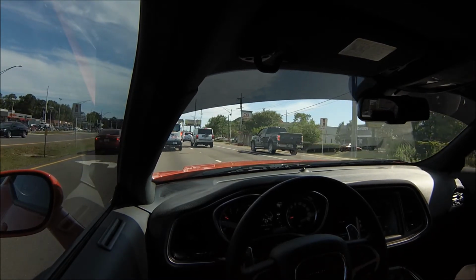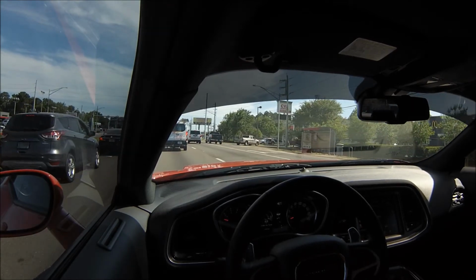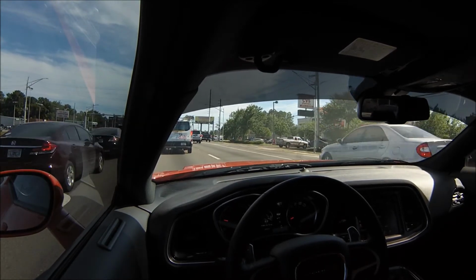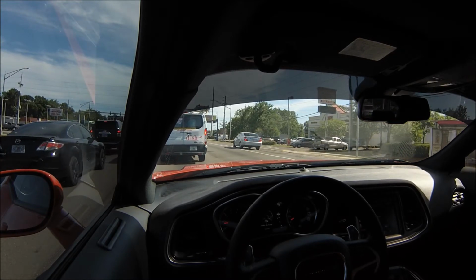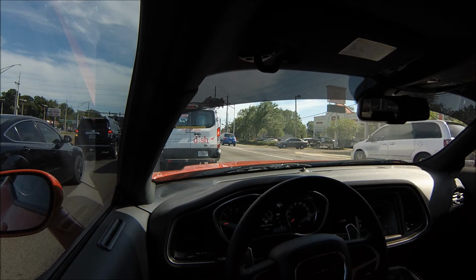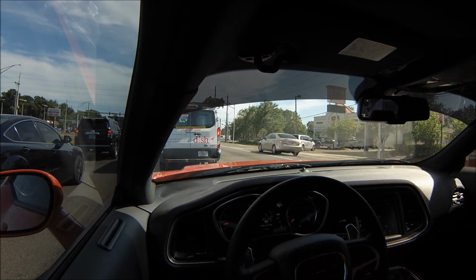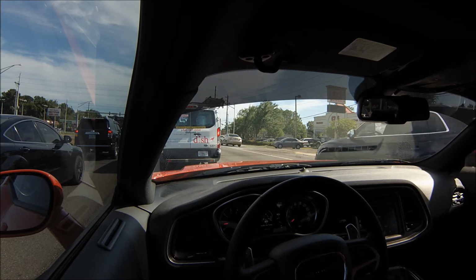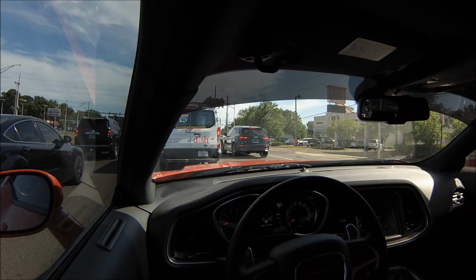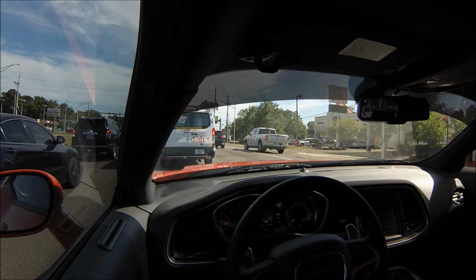Now, one thing I did notice this morning on the way home from work, when it was right around 73, 74 degrees by the dash readout, it actually got down within about 2 degrees of ambient, and that was at steady state cruise. You are getting a little bit of air stagnation in front of the throttle body, so it does heat up a little more.